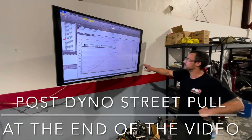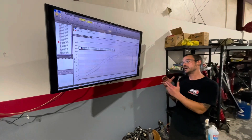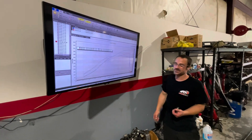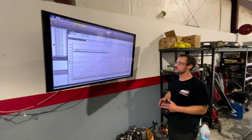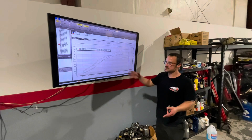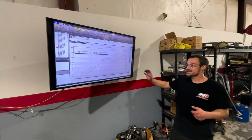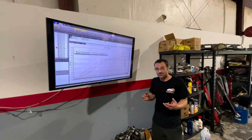613 horsepower and 460 foot-pounds of torque. She carried power out. It's starting to get real tight on that turbo, and it's really just hot out — all the way back up to 95 degrees — which makes it really hard for a turbo to breathe. If it was a little cooler out, sure, we'd be doing 630, 640, no problem. Or even if we were just spraying methanol, 630-640 would be really easy, just keeping those temperatures down.